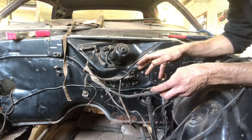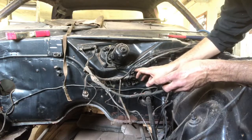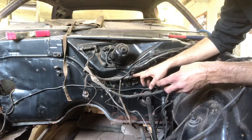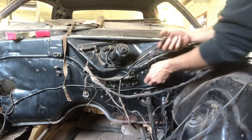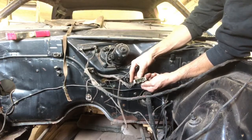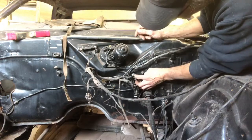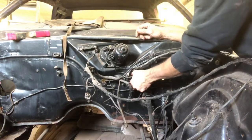It'll be totally labeled and I'll be able to run it where I want. I've heard that the glass fuse block on these are notorious for shorting out, so this is my big reason why I want to go with a different wiring harness. So let's take this apart and we'll see what kind of condition it's in. It's just two tabs on either side — pull it apart. They're a little corroded in there. We've got one that's a little bit melted; it looks like it got hot at one time.